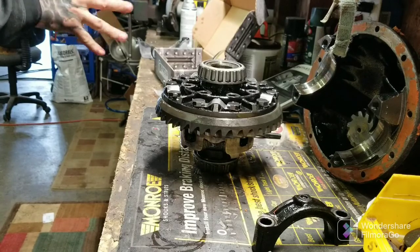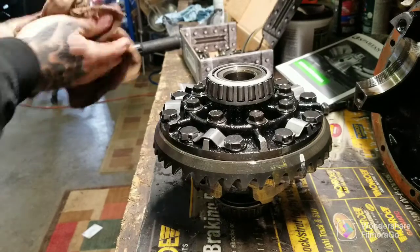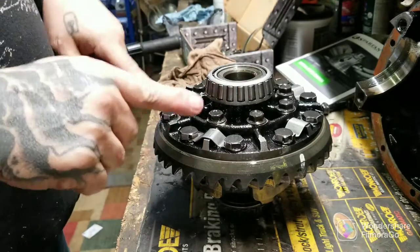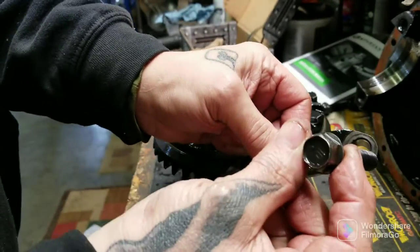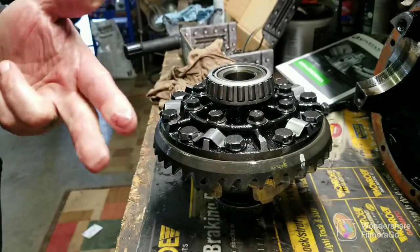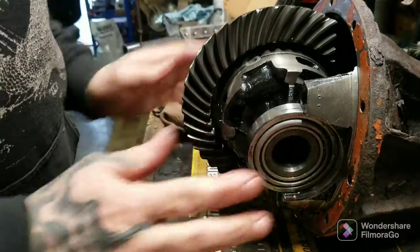I'm going to pause this and look up the torque specs on the Google machine here real quick. If you're a familiar Google machine user, you know you're going to get 67 different answers about torque specs. I found a factory service manual page that said 75 for these bolts, and when you put the caps on the ends down here, that takes 90. Some people say crank them until you can't crank them no more, but 90 is what I saw the book say. Bearings and everything went back in place — this didn't go too bad.